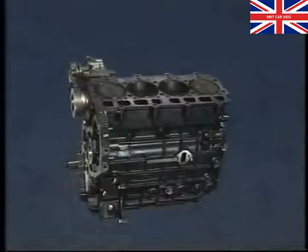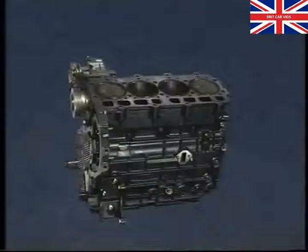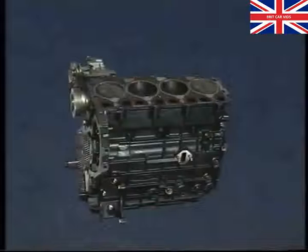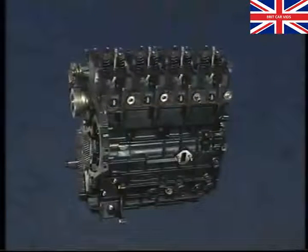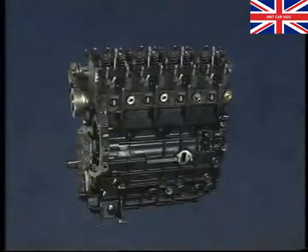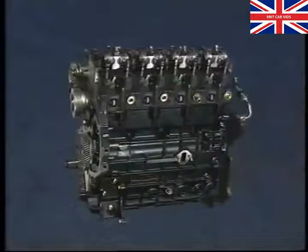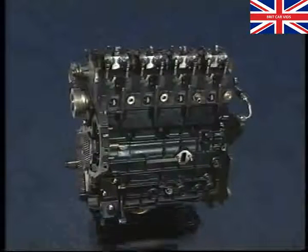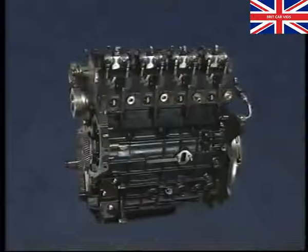The oil pump, brake servo exhauster and camshaft are all gear-driven from the crankshaft. Selective head gaskets are used to seal the separate cylinder heads. The valves are operated through push rods and rockers with conventional valve clearance adjusters. A steel adapter plate provides a mounting point for the new 5-speed gearbox. The pickup strainer draws oil from a laminated sump. The flywheel, clutch plate and diaphragm sprung cover plate are all quite conventional.